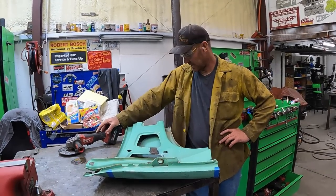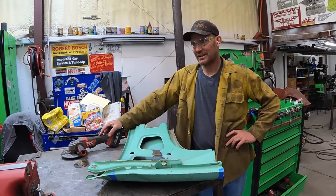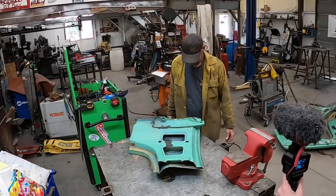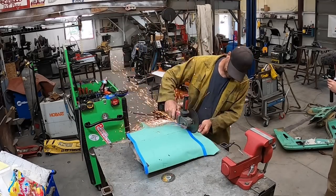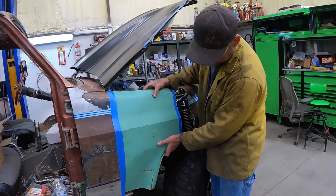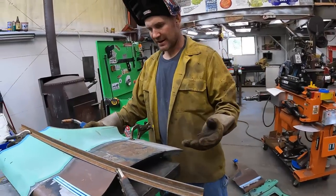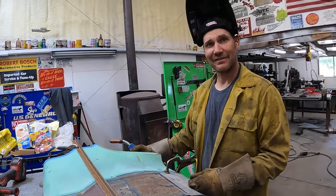We're getting somewhere. I think I probably just want to cut this whole inner structure out. I'll bend something on the inside to weld it to the inner fender. I cut it long everywhere, I think - that's gonna fill it up pretty good. We're gonna take these two pieces of fender and weld them together, then figure out the length on the other one. We're getting close - we're gonna start tacking this thing together.